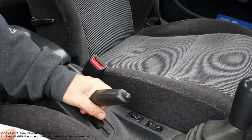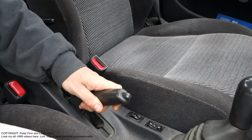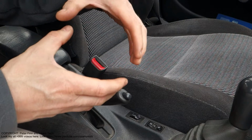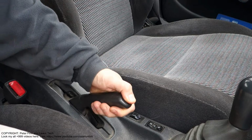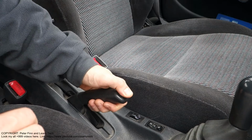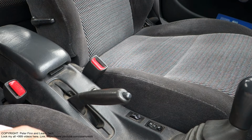And then there is a second interesting possibility: sometimes on these cars, the braking shoes and braking drums become so rusty and corroded that the brake shoes can't move very easily. There is so much friction, and we need to lubricate those brake shoes and also their contact areas. This is the second point. And the third point, which is not so normal, is that our handbrake system is so rusty that sometimes we need to lubricate all those joints and connections and cables, but it is very unusual.